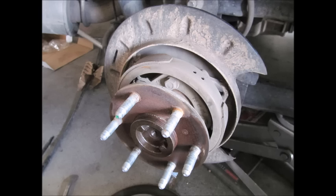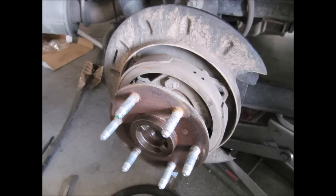Here's the rear — it also shows the emergency brakes, but it's very simple; you can probably find another YouTube video for that. So there you go: if you have trouble with your steering wheel shaking when you apply the brakes, it's most likely the guide pins, the brake pads, or the rotors. Good luck.